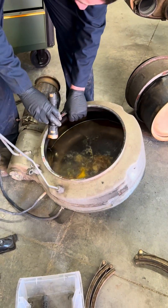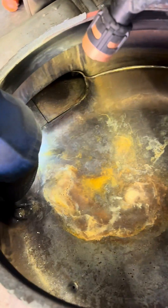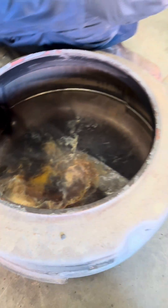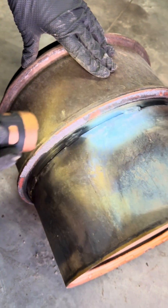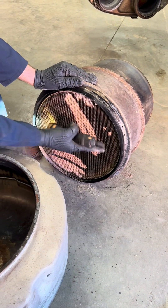We've also got a lot of soot — it's even down here on this NOx sensor. There shouldn't be any soot after the DPF. It looks like this filter is actually leaking soot. It had a strange color and also a large amount of ash built up.